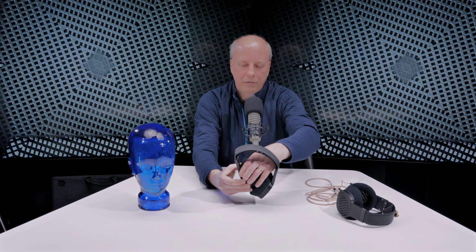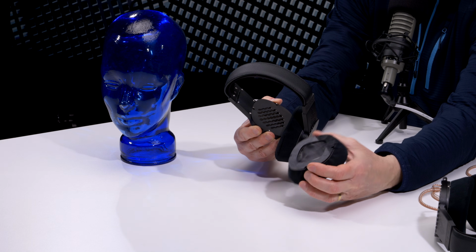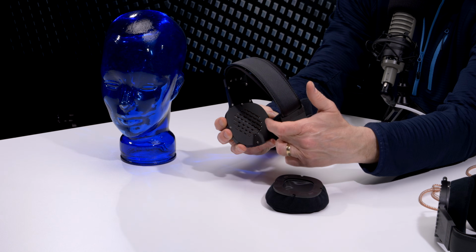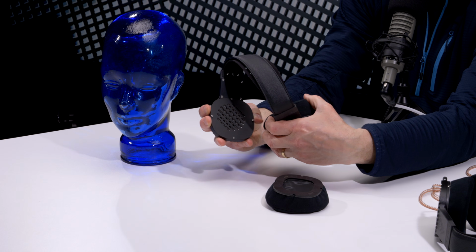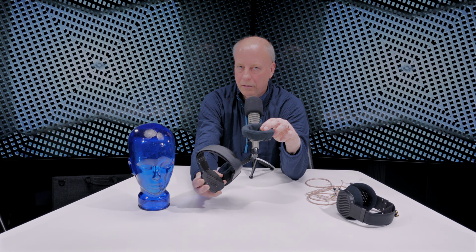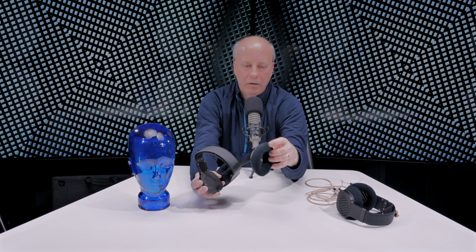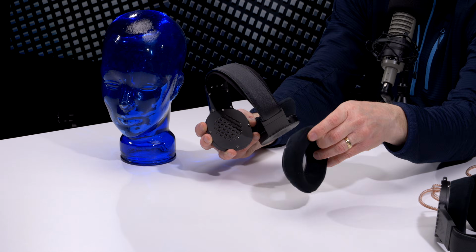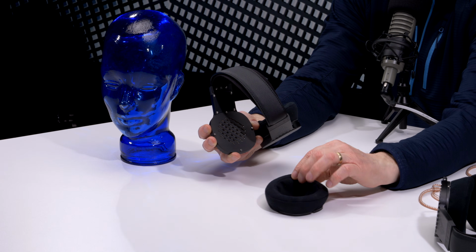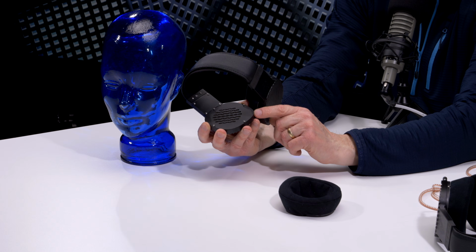And these ear pads just come off very easily. They're magnetic. They just pop right off. You'll see there's 4 little notches, one on each side, that align to 4 screws that are on the face of what we call the speaker baffle. And typically all the ear pads that you'll get from us are beveled or angled in shape. There's one portion where the stitch is that is the thickest portion or the widest portion of the ear pad, and that stitch line and wide portion will line up where the cable plugs in.